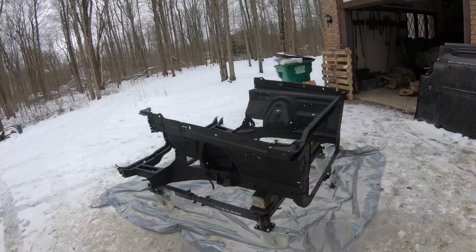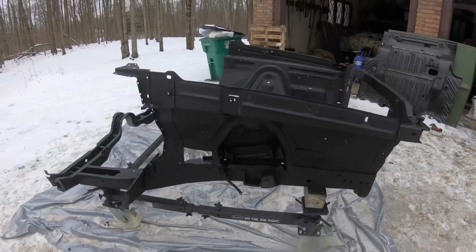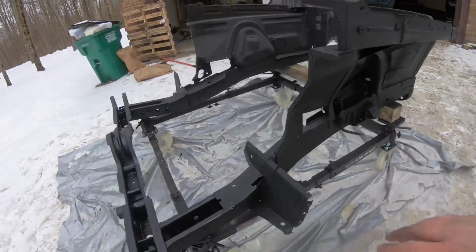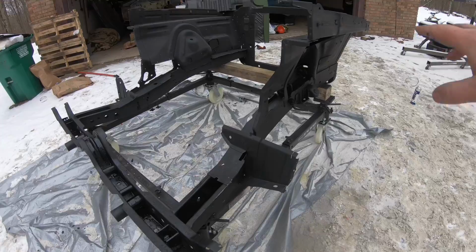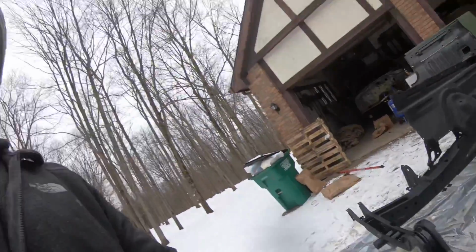All right, guys, just like that, we are done with epoxy paint on this front clip. As you can see, it turned out really, really nice. Looks exactly like the other half did. But all one coat now, it's protected, the metal's protected, and as I showed you guys, it's direct metal application with the epoxy primer. I did want to introduce one new coating to you guys here.